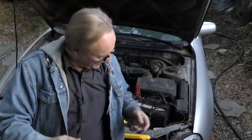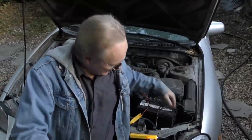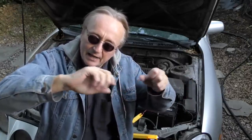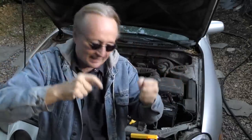The other way you can hurt yourself would be if you had metal in your hands, and that metal connected the ground circuit to the power circuit — like putting metal from the positive to the negative cable. If your hands are on that metal, it's going to get real hot and burn you. So don't wear rings that can short things out; have bare naked hands, and you can't hurt yourself with 12 volts.